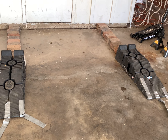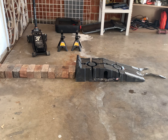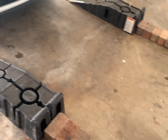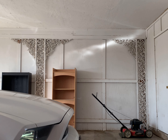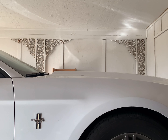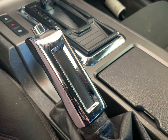I got the ramps lined up here. I use the bricks as a support so that the ramps don't slide. Gonna just drive my car up onto these. Once you get it on the ramps, just make sure you got your e-brake or parking brake pulled up.